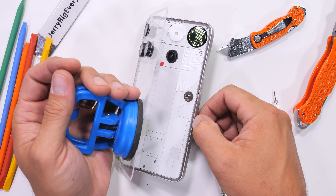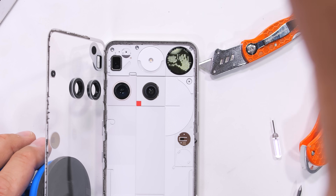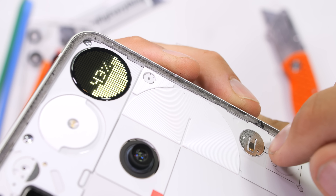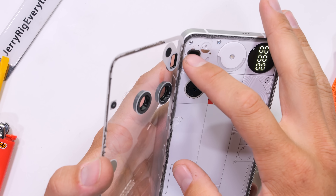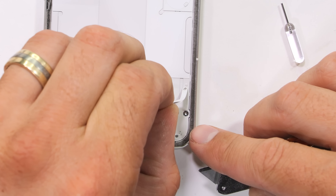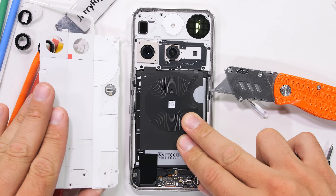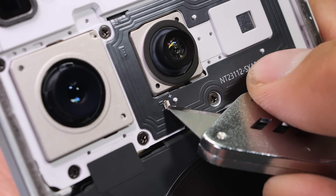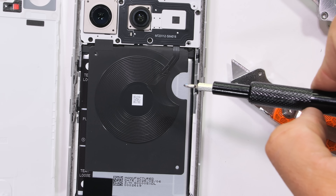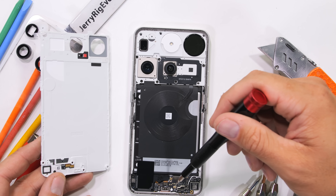With the back glass off, we realize that indeed the glass is totally clear, and the Glyph Matrix screen is left behind in the body, along with the physical capacitive conductive metal button that can feel your finger through the glass. The cameras themselves are all still here doing their own things, and the raised camera bumps are pulled away with the panel. There are six visible silver T5 screws scattered around the white plastics, with two more hidden under a flap in the bottom right hand corner. With those gone, it does look way better naked, and the red diode is actually just a normal white diode with a red filter on top.